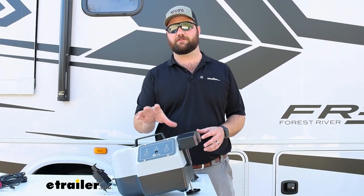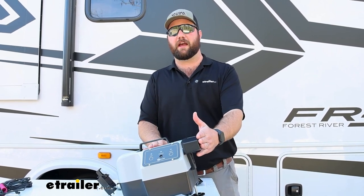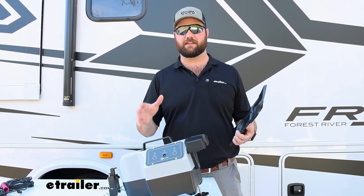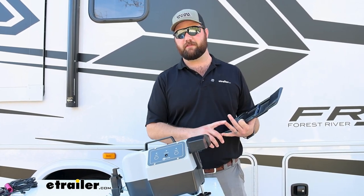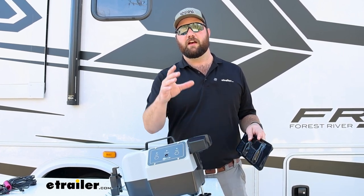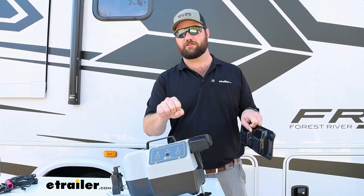Because the Patriot has such a strong pushing power on your brake pedal, that means it's going to need a good backing to be able to push against. So it's going to butt up against your seat and then push your brake pedal. Well, again, because it's that strong, it needs something more stiff to be able to push off of. Typically, we see with cloth seats, it can be an issue because the cloth doesn't have any rigidity to it. Leather seats is usually not a problem because the leather will not allow it to stretch too much.